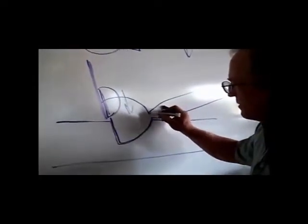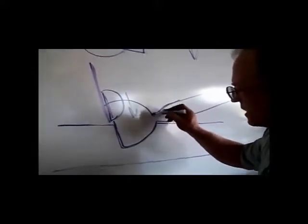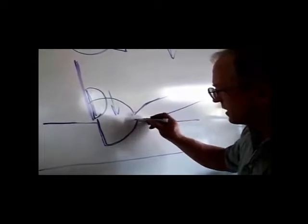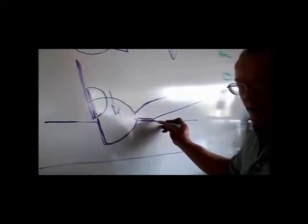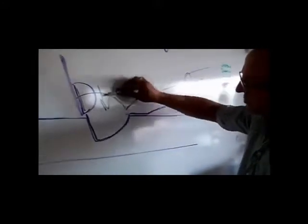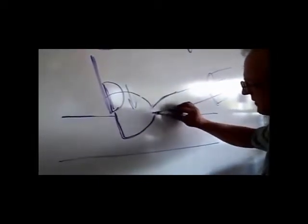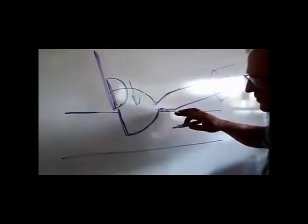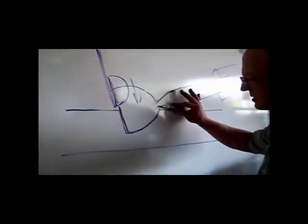But if you look at your bits, there is a 15 degree angle right here just past the bit cutting surface. The cut goes all the way to here. All right. This is undercut so that this angle here, when it's perfect, will lay flat on the throttle body like that. This is the angle of your Dremel, and here it's attached this way in your chuck. Okay? So you see why you have to move it straight. And just look at your angle. If the plate is a little bit too steep, then change the angle of your bit, because this is the most important spot to look at when you're cutting the groove, the angle at the taper just past the cutting surface. You'll see it. All right, so that's the angle you want to be parallel to the airstream.